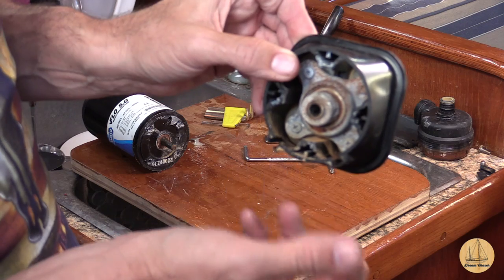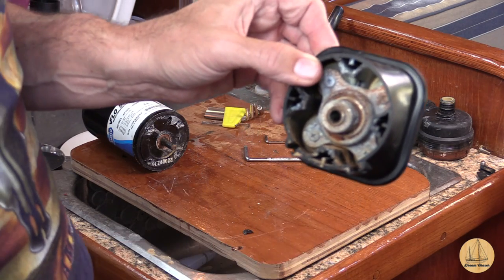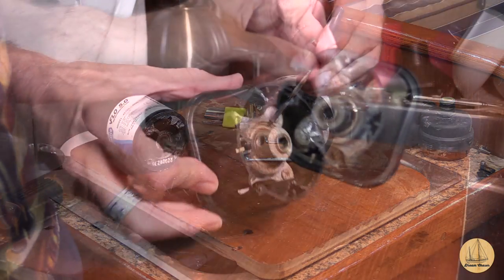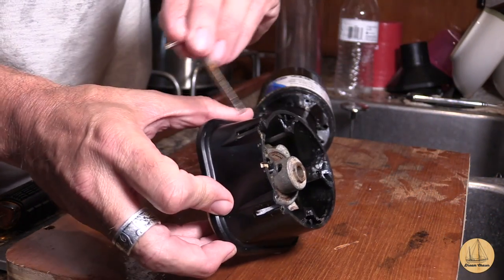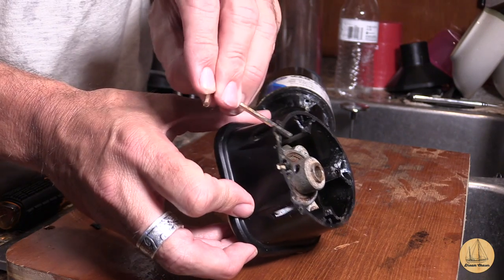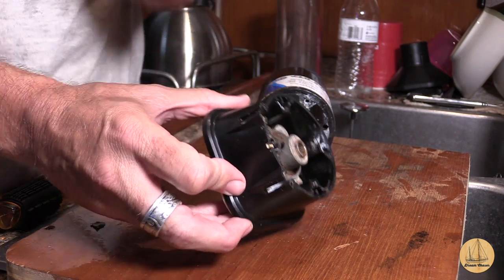If not, we'll have to buy a new pump. But a rebuild kit is probably going to be $50, $60, $70 versus a pump for $350, $400. The set screw goes right here, and the shaft obviously goes through here, so you have to line up these little weep holes on the side with that Allen wrench to be able to adjust this.